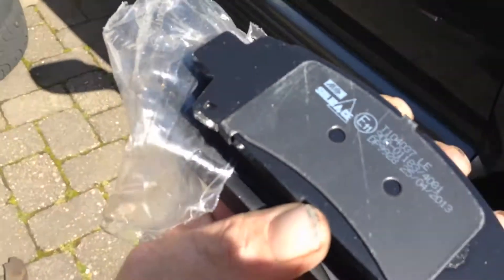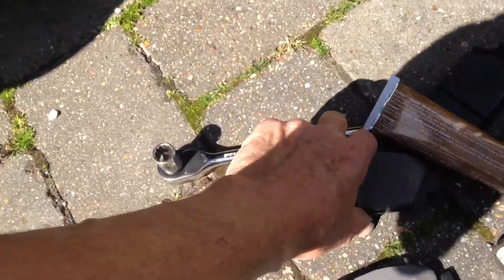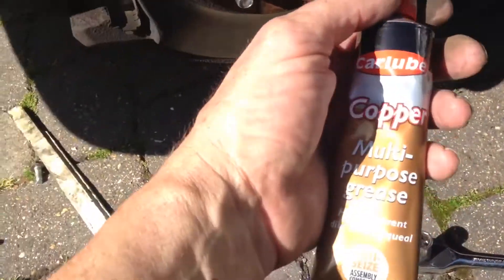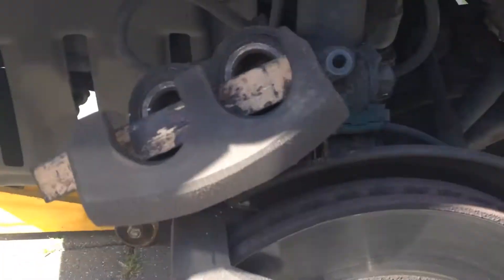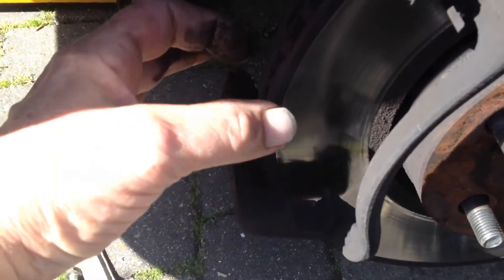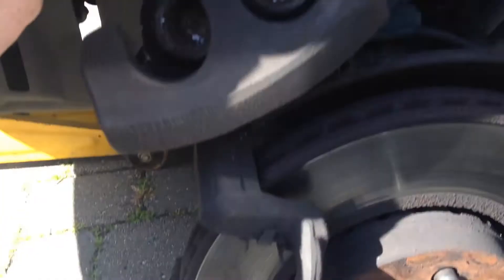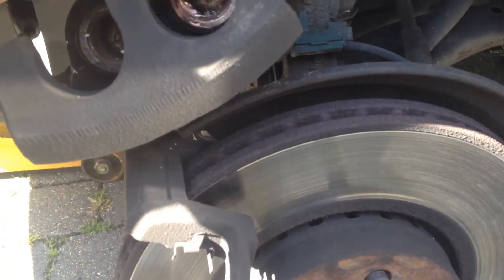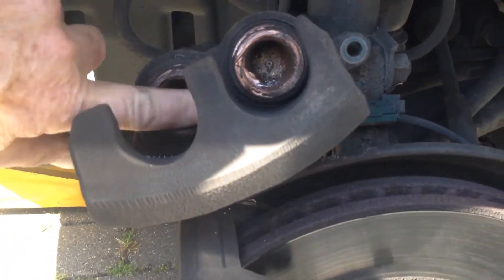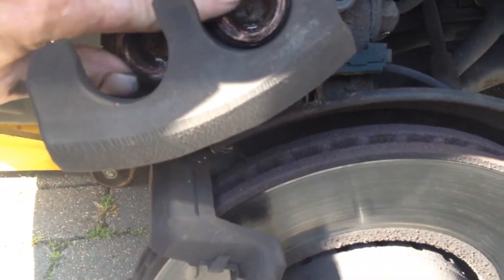This thing is to make it stop squeaking, so I'm still going to use a bit of copper grease. I've done the dirty work already — I pushed the caliper back in because that'll sit right on top of the brake here and squeezes the brakes in. So I'm going to put a little bit of copper grease on these calipers — just a thin coating.